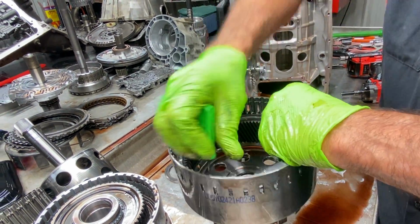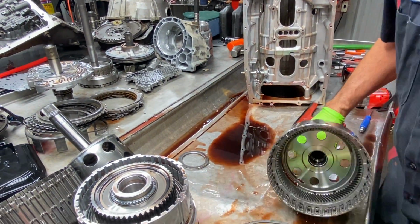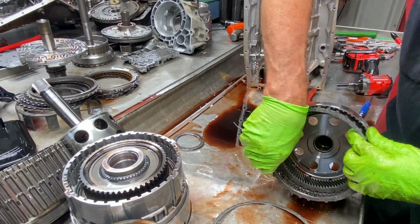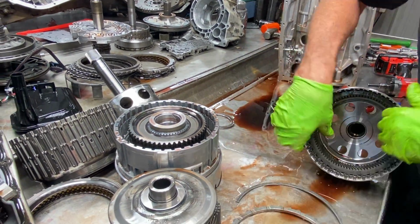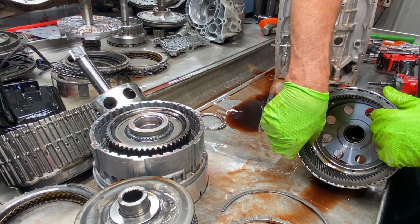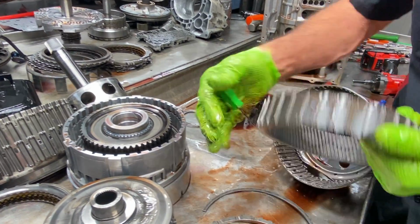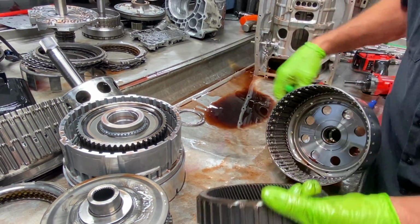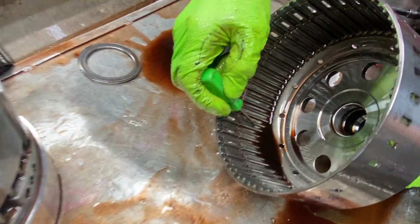This ring gear right here, especially when they're really trash with metal, you got a spacer that comes out first. The spacer, no different direction, going either way. But this ring gear will go in one way only, okay? It's flat coming out on this side and beveled on this side. The bevel goes in. But when you get down in here, look at the metal that's in here.